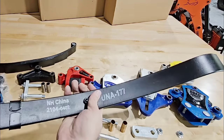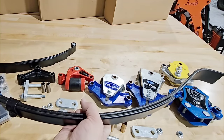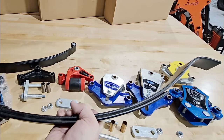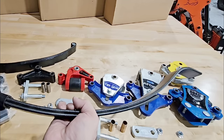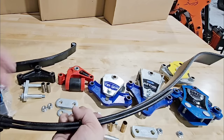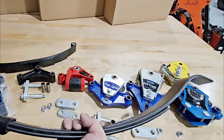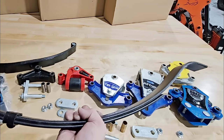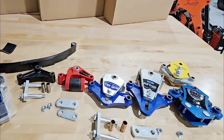That's called a slipper spring. It's very common on utility trailers, cargo trailers, and dump trailers. Slipper springs have been around for a long time. Some companies are making suspension replacement systems that switch traditional leaf springs to slipper springs, but I don't necessarily see a true benefit between one versus the other. On RVs you'll predominantly see dual-eyelet springs, while slipper springs are more common on utility and dump trailers.